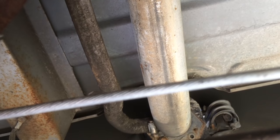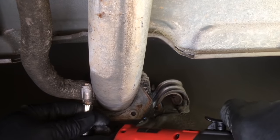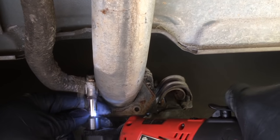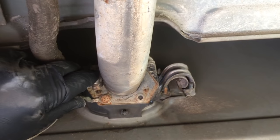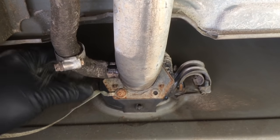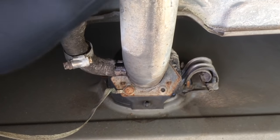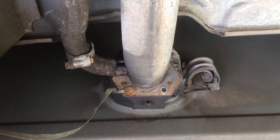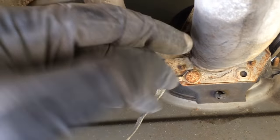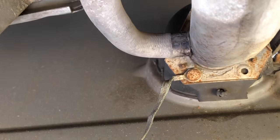We're going to come down to the vent pipe and do the same thing — loosen up the clamp. There's going to be lots of dirt and debris and crud, so make sure you've got eye protection on. We're going to remove this one as well because it connects to the fuel tank. I've cleaned off a lot of the dirt and crud so there's not so much debris falling into my face. Now, for the vent hose...